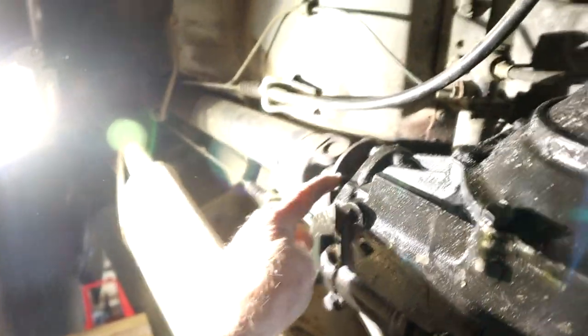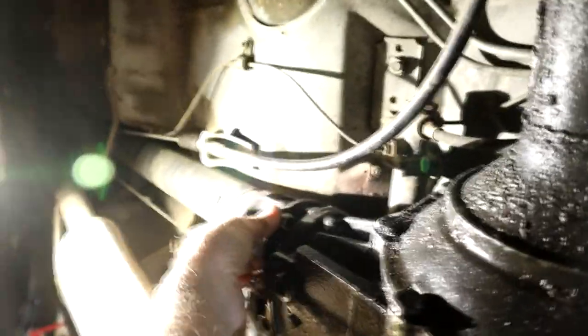As you can see it's all covered in oil, and it's working its way from the front — as you've been driving it, it wicks its way back. So what we're going to have to do is undo the driveshaft here with these four nuts. I put it in neutral so we can spin the driveshaft.